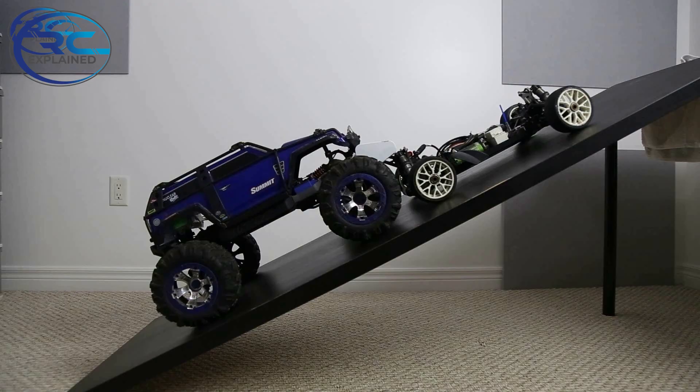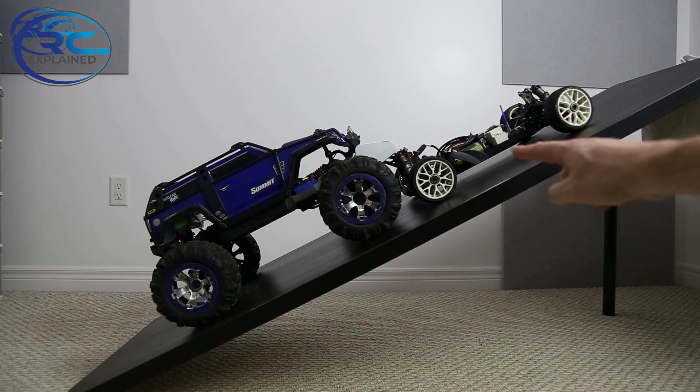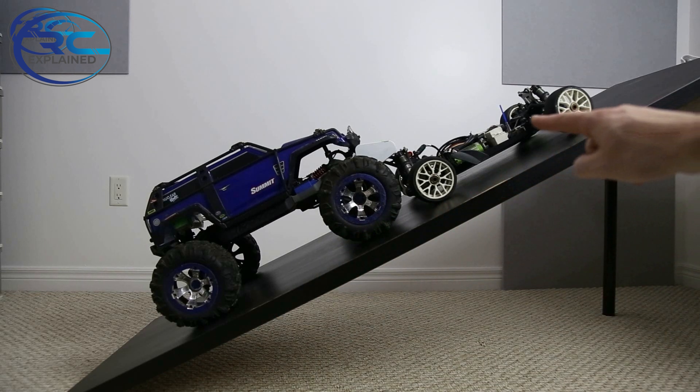That's a difference of only 230 watts. I would bet the vast majority of us would not notice that much of a difference — maybe a subtle difference, but nothing significant enough to warrant spending a lot more money on the better performing pack. To answer our original question: if your expectation is to get good performance out of your RC vehicle, 1,260 watts might be exactly that, and there is nothing wrong with seeing good value from a below-average battery pack if you don't expect it to be the best.